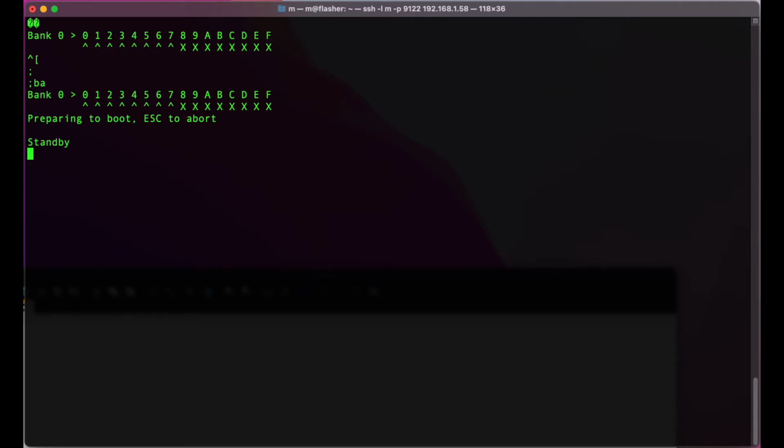So the plan today is to test the IBM 0665 hard drive. It's nominally a 44 megabyte MFM interface hard drive. It's a full height 5¼ inch hard drive, and it's really heavy, even by olden day standards. That's because it's a very solidly constructed drive.